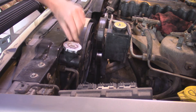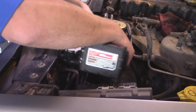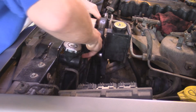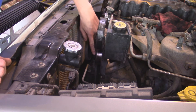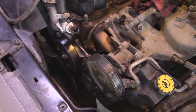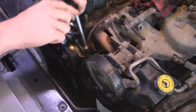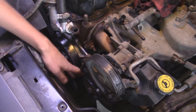You're going to take this overflow line and push it out of the way, and then you should be able to remove the fan. There's going to be a wire connection, and then you should be able to lift this out of here. Now to remove tension off this belt, there's going to be an idler pulley down here. We want to crack that loose just a little bit, and then there's going to be a long bolt on this side — loosen that up and it's going to take tension off the belt. You're going to need a 15mm — put it on this idler pulley down here and just break it free. Then take another 15mm and loosen this bolt right here — this is your actual tensioner.